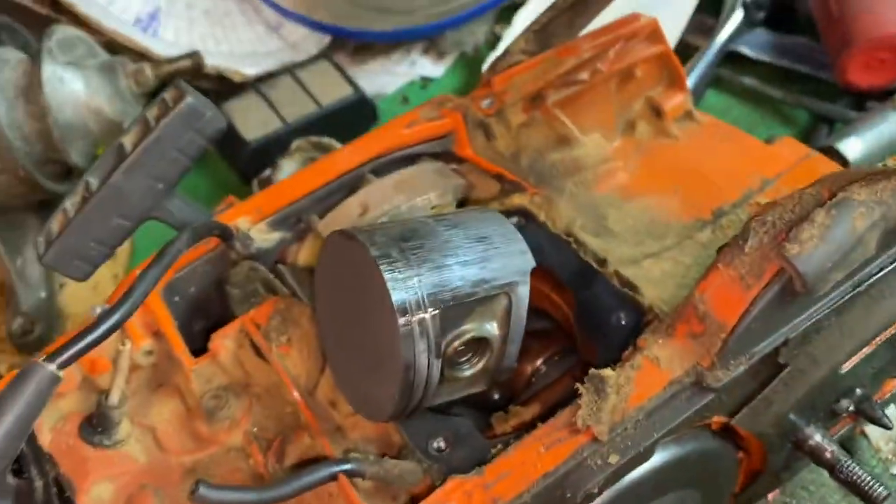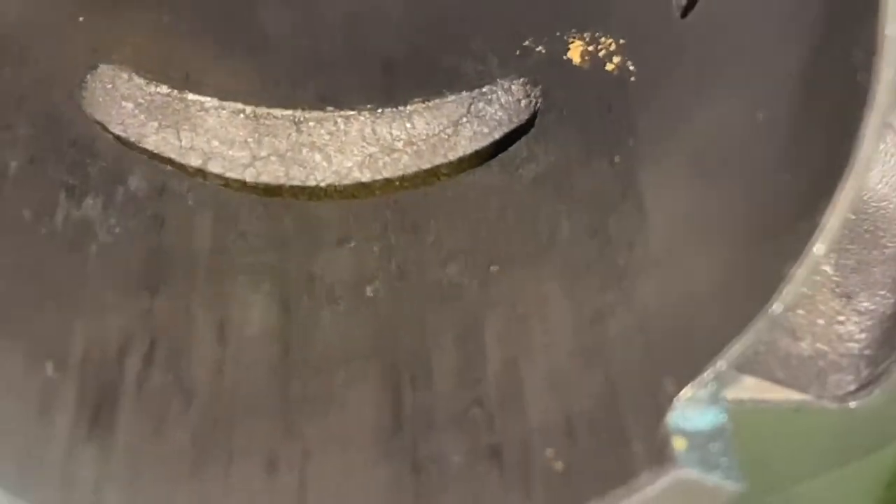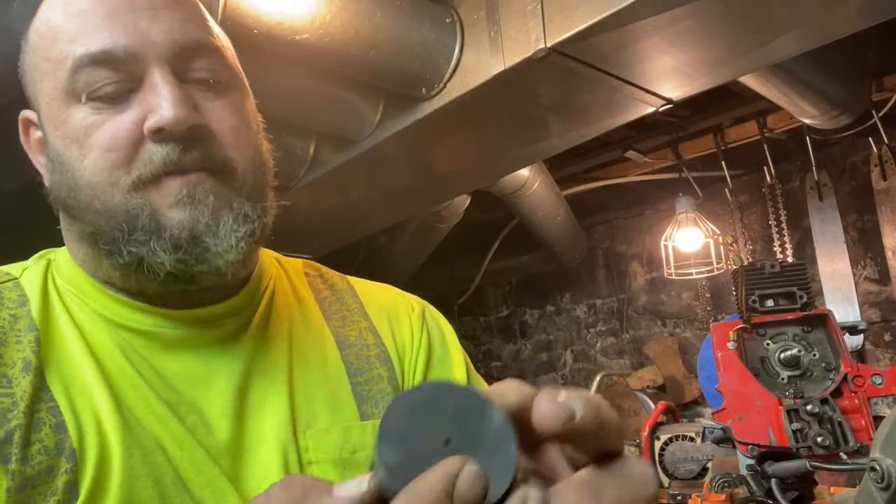Let's look at the inside of the cylinder. Here's the side we're looking at — let me zoom in. That's a lot of transfer. Feels like World War 3 in there. I can't clean the piston up — it's actually got a couple of chunks missing right at the rings. It would never seal up if I even tried. It's toast.